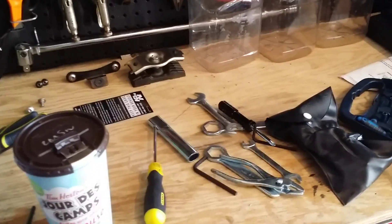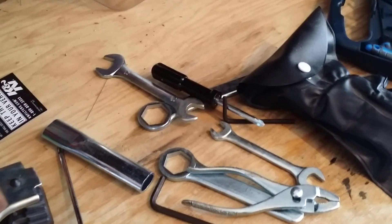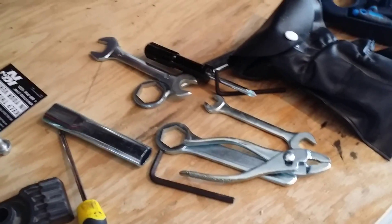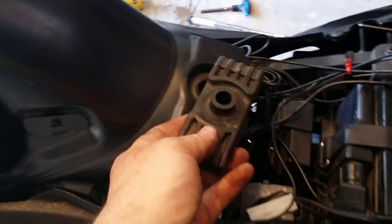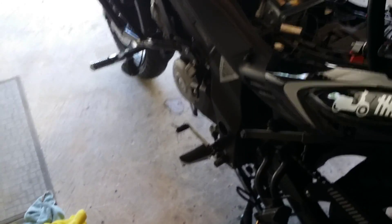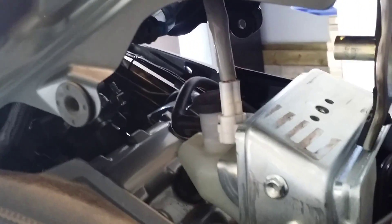A cool little trick from the manual: this is the bottom bracket that holds the gas tank — there's the bolt — and this is the top part that goes underneath. What you can do is prop up the tank with the metal piece, and that gives you room to properly connect the hoses. You can see the tank held up there. With two hash marks of fuel it didn't leak whatsoever, which is cool. Now I still have to connect these three connectors here, but I won't unbundle them until I get the main one done — we're almost there.